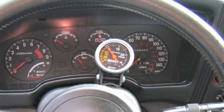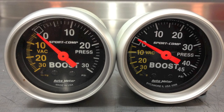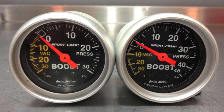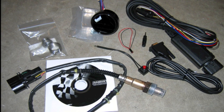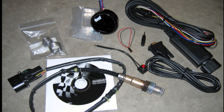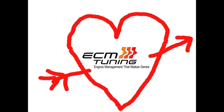After that exciting moment, there were still a few items left to tackle before we could go for a drive. First was to get rid of my very wimpy 30 psi boost gauge and upgrade to the Manly Lumberjack 45 psi version. Next was the simple but time-consuming install of the Innovate Wideband Oxygen Sensor — an excellent, affordable tuning tool made a thousand times better since you can program it to include its readings into your ECM Link data logs. I just want to hug the guys at ECM Link for this one.